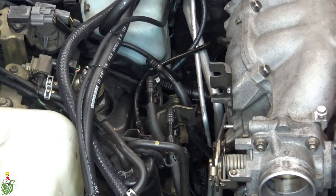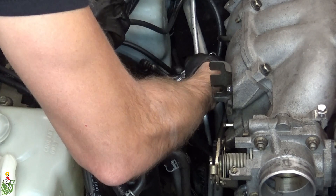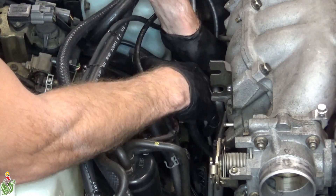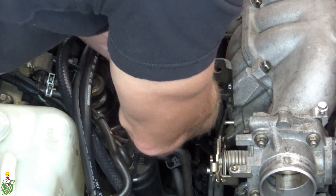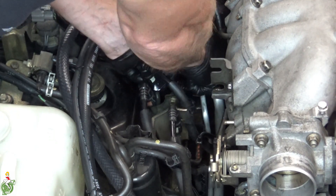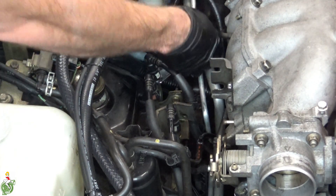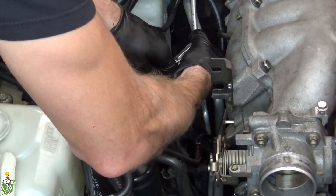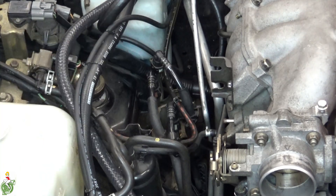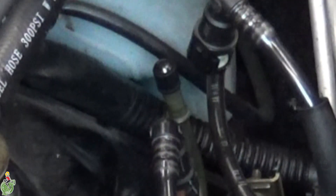Free some of the clips on these fuel lines with needle nose pliers. Next you have to remove your main fuel line — you can use a 5/16 inch fuel disconnect tool, available anywhere like AutoZone or Advance; they're cheap and easy to find. The first time you do this it's going to be challenging. You want to keep it close and tight to the tube, get it inside of the outer sheath, and then basically just pull up — you don't really have to separate it; if you just pull up it will release the clip inside and the fuel line will come apart. This is one of those jobs that takes 60 minutes the first time and after the fifth time it takes like three minutes. A Schrader valve stem cap fits on the exposed metal fuel line and should help cut down some of the fuel fumes in your garage.